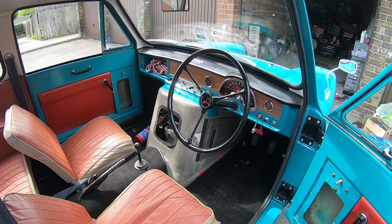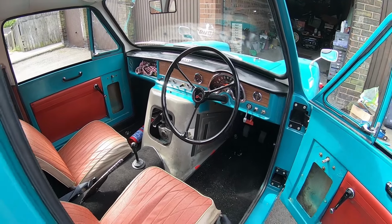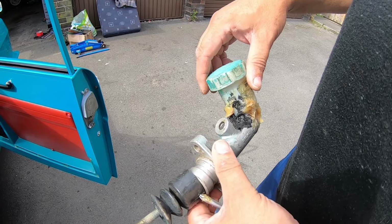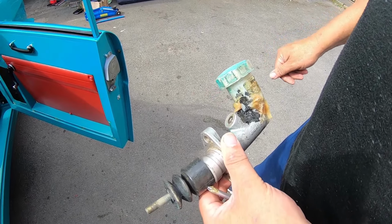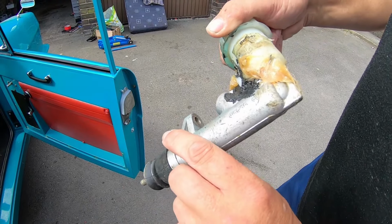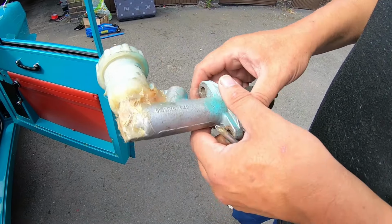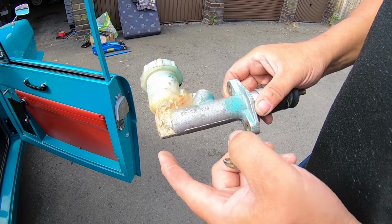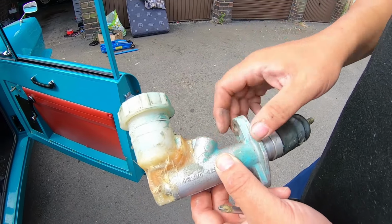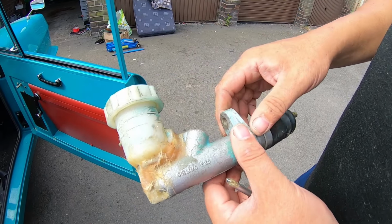The only other thing that I forgot to mention on the last video was the master cylinder. I've changed the master cylinder on the car. This is the old one, and this is a new one that I fitted. If you remember in video 1, if anybody's watched video 1, they know I had to replace everything because somebody put mineral fluid in it. Now, as you can see, this is looking a right mess. Basically, it's a master cylinder that's got a separate plastic reservoir that seals with some rubber O-rings in there, and it were weeping. I were constantly getting drips from here, and whenever I'd come to the garage it had dripped 2 or 3 drips, and I wasn't happy with it. So I tried to bodge it because it's not on the pressure side. I tried to bodge it with stuff, and obviously that looks a right mess now.